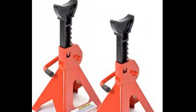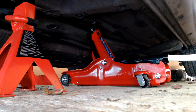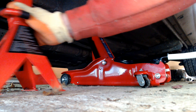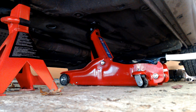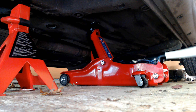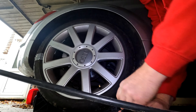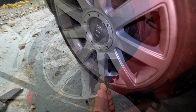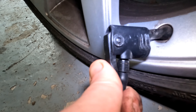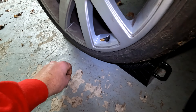Another alternative to wheel turning to save the perishing of your tyres is to put the car up on axle stands over winter and take the pressure off. However, it will prevent you from rolling the car out of the garage and firing it up once a month, which I intend to do. The tyres should also have an additional 5 to 10 pounds of pressure pumped into them while stored to give them better protection against flat spots and perishing. Remember to check this when you take the car out of hibernation or you could be in for a bumpy ride.